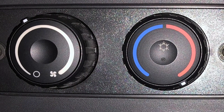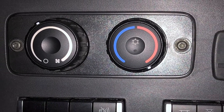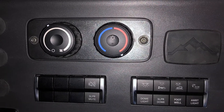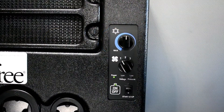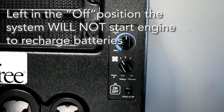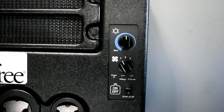To ensure comfortable sleeping conditions, properly set the HVAC controls in the bunk before going to sleep, in case a start-stop event is needed. If the start-stop switch is left in the OFF position, the system will not start the truck's engine to recharge the batteries and the EAPU will shut off when the batteries run low. The EAPU display will show a low battery LED. However, this may be necessary at customer locations or in municipalities where idling is not allowed.